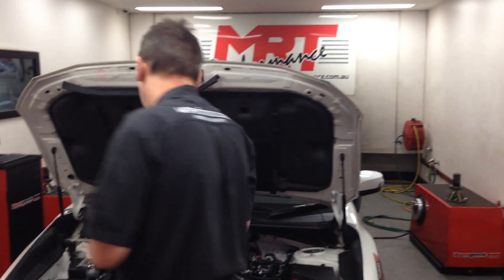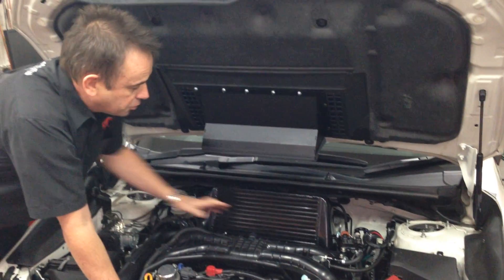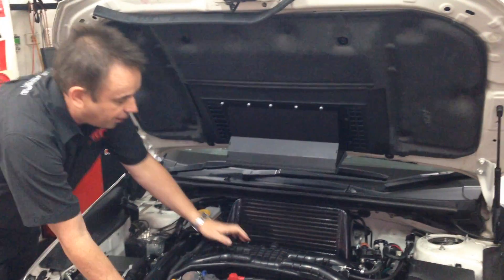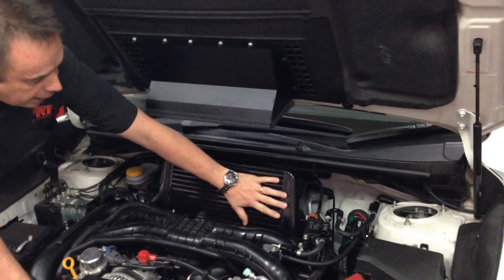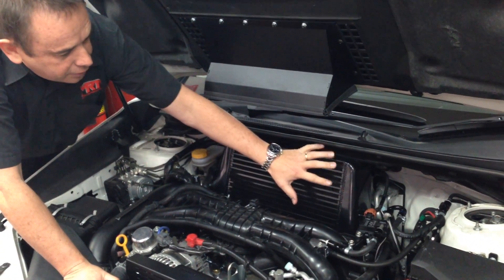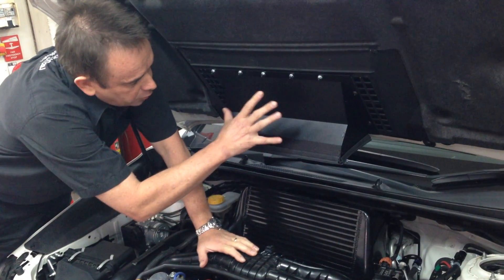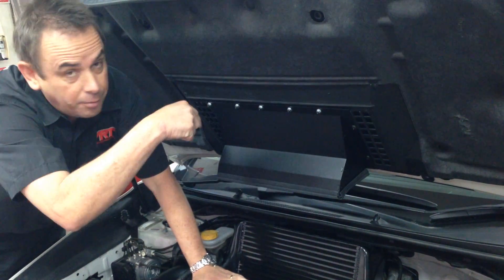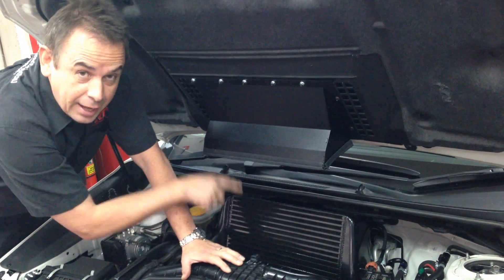Let's have a look at what Kevin's actually designed to fit in the new Subaru. The current MY15 has a horizontally mounted top-mount intercooler with a bonnet scoop built into the classic scoop on the bonnet. The verticooler allows the intercooler to be fitted in a vertical — or almost vertical — position by replacing the factory intercooler. It comes with a whole new splitter and duct system that bolts up into the factory standard undertray under the bonnet, with no modifications to the actual bonnet or bonnet scoop. The air is directed to flow into the cooler and down out around the gearbox.